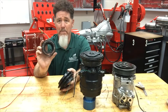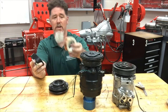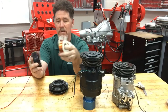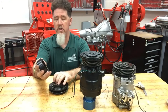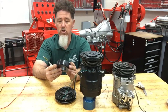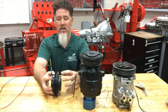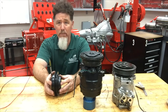The coil is nothing more than a monster coil of wire. I have one taken apart — it's a coil of wire wound around hundreds of times. What this does is that any time you take a coil, like your ignition coil, and put 12 volts to it, it creates a magnetic field. That magnetic field is going to expand around the pulley and around the hub, connecting them together in a strong magnetic field.